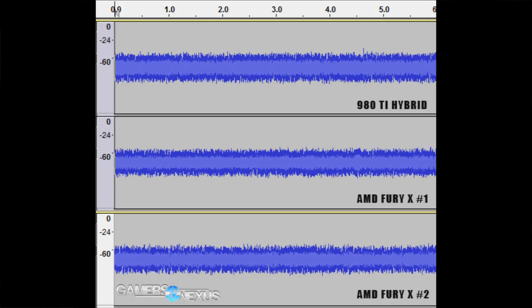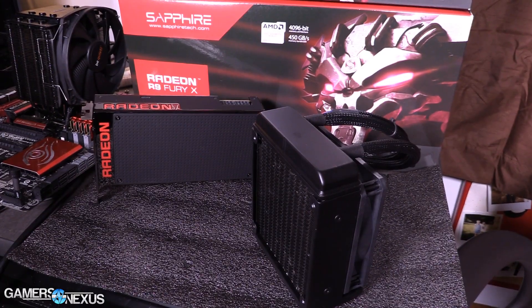In the real-world use case on our open-air test bench — with all non-essential fans disabled — the card is roughly two feet from my ear and the frequency is definitely audible. In an enclosure, however, we tested in an NZXT H440 and a Rosewill Throne, positioned about three feet away from the case, and I could not hear the whining. It is absolutely present in an open-air bench, and if you're using an open case like an Antec Skeleton, you should consider the whine. But if you're building in an enclosure — which is probably most people — and the audio concern is the one thing keeping you from buying the card, I would say it is of no consequence.